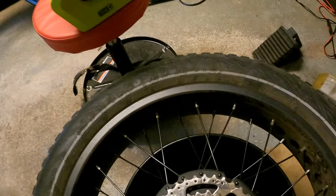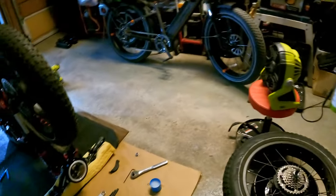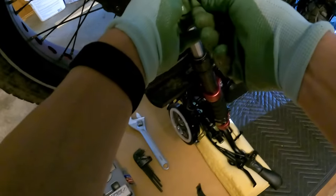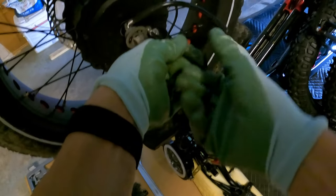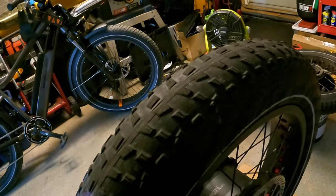We can use this bucket here and place it on and lean on the spokes here. That will make working with the tire easier. Two Torx things off. And then I'll remove the wheel. Again, it's a good idea to use threadlock glue on these later on when you're putting back on. Bikes have a lot of vibrations, so it's safer to put those back on with some threadlock. Feel much safer that it won't shake off when I'm riding.